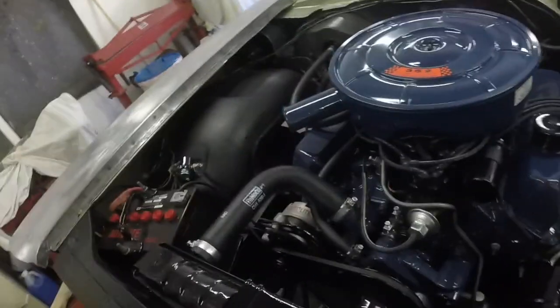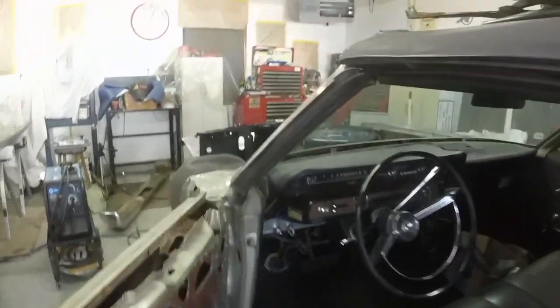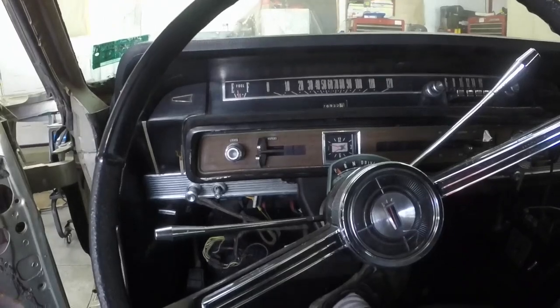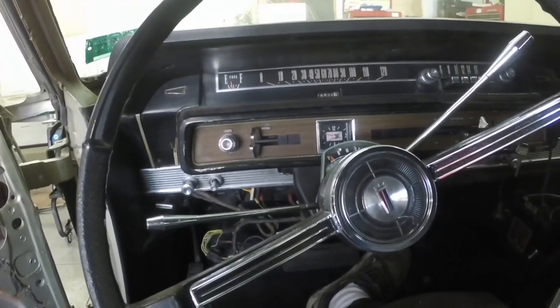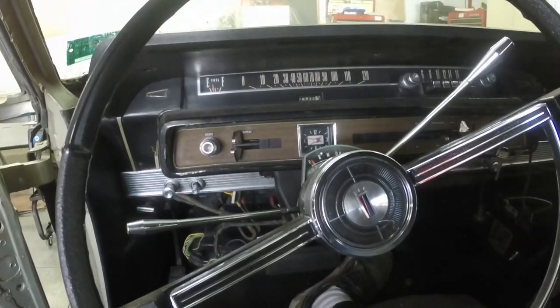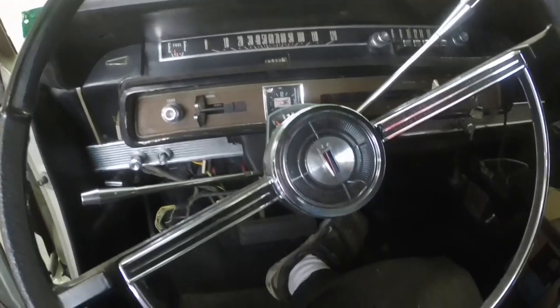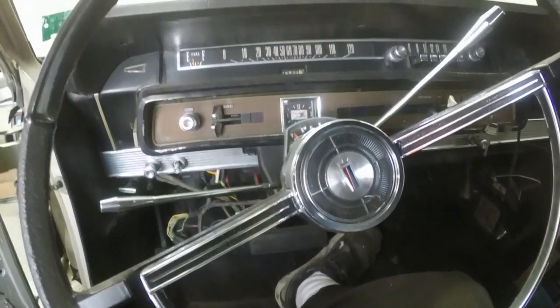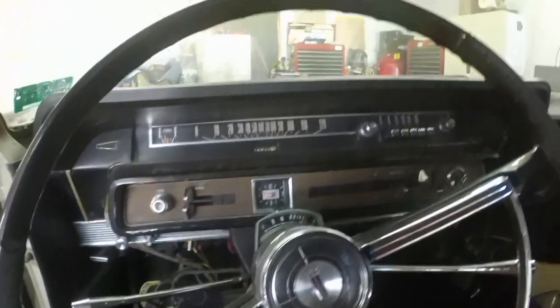As you can see, it idled good before, but when I took it off of idle, it would miss real bad and the timing mark would jump all over. It's as steady as a rock now when you give it the gas. A little bit of gas, it's as smooth as can be. Before it would run really rough there. So I'm really happy I set the idle.